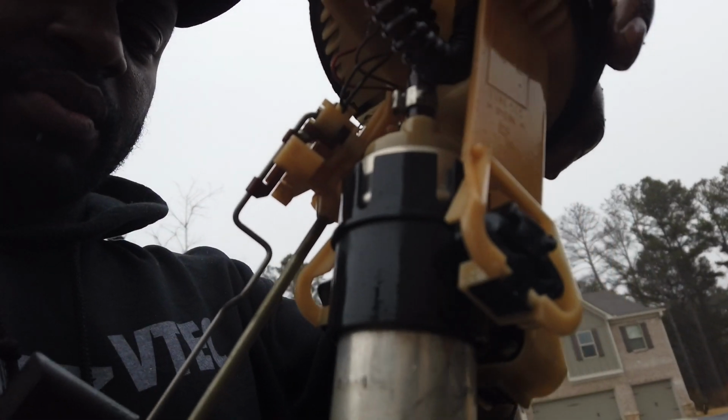Now, removing this fuel pump from Ebony isn't a bad thing since she needs a fuel pump anyways to support the turbo. This stock fuel pump won't do anything with some 60-pound injectors and especially trying to run E85. So it would have to come out anyways. I still need the holster, which I can use the other one if the pump is just bad. Yeah, just swap out the pump with a better pump. Haven't decided what pump yet. 340 or 450, 485. I haven't got that far.